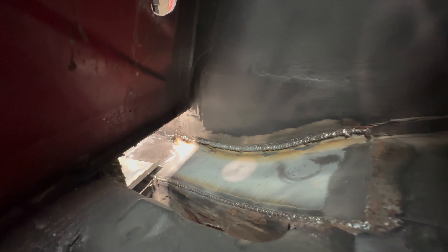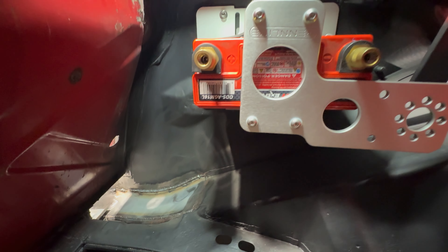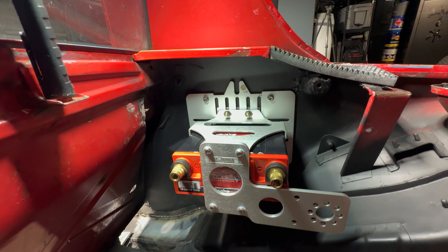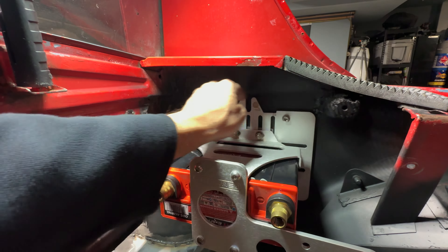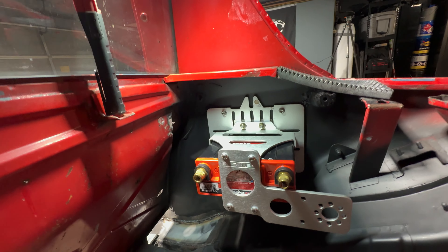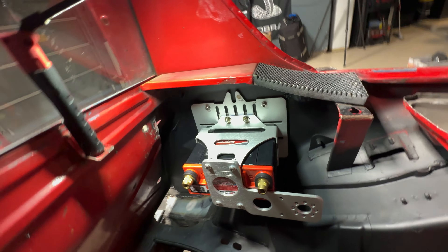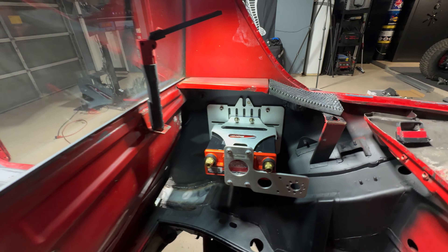There's our patch panel installed with a nice heavy bead across both sections of the panel, so it's nice and solid. While we're in here I had this Redline battery box for a 911 — went and mounted it with four riv nuts, super solid in the chassis, that's not going anywhere. They are safe to mount in this direction; I will cut the kill switch tab off. It's super compact — I think it's more compact than the factory location. I might get creative and try to turn it 90 degrees to make it as flush as possible.